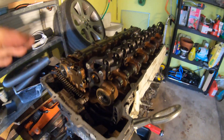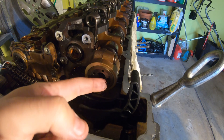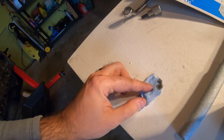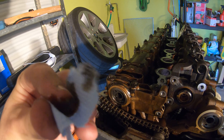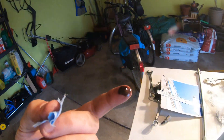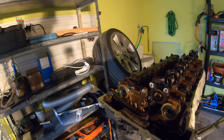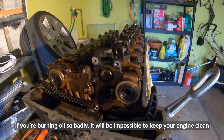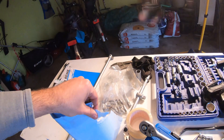I tried to start taking this engine apart, but I wanted to show you what a sludged engine can look like. This is like black tar. It's not just dirty oil — it's like a black paint, almost. And this one's milky too. I know people say you can clean your engine with all these products, but honestly, changing oil more often and keeping it clean is the best way to go. There's just so much black, tar-y, milky kind of substance on this. It's terrible.